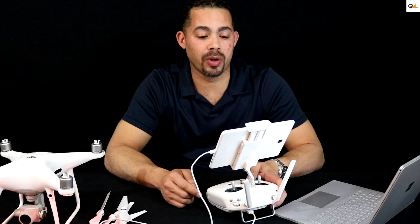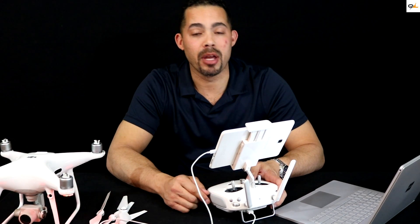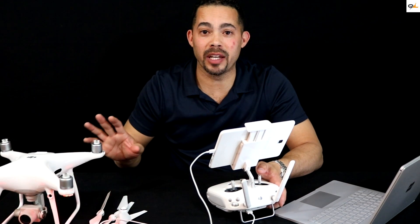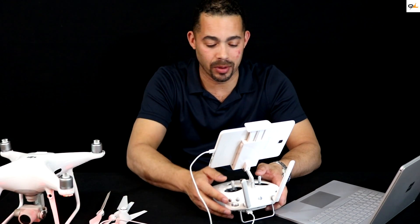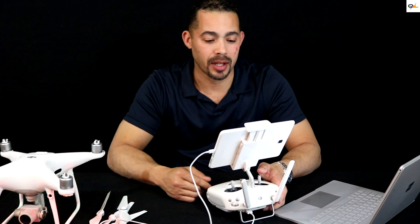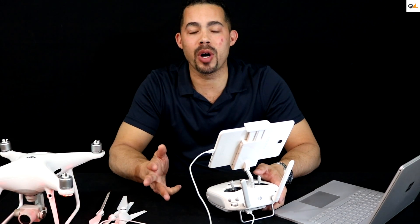Once you go to fly, it's going to let you know that you need a firmware update — if you can deal with that, this may be a better option for you. At least you get some of your functionality back. I'm going to go ahead and start the motors. That sounds perfectly normal — before it made this click-click-click sound once it started back up, which wasn't normal. The motor sounds smooth, more stable. We shut down the motors nice and smooth. Another thing — my app is not crashing; normally it crashes by now, but right now it's working like it's supposed to.